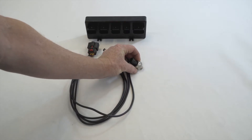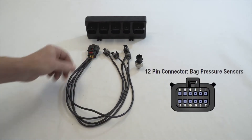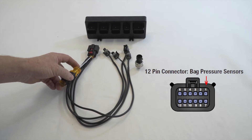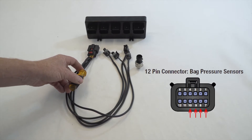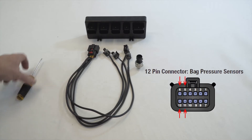The connector is the last one on the end, and it is numbered the same way as the height sensor harness: corner one, front left, is pin number one; number two is front right; number three is left rear; and number four is right rear. The power on the bottom is five volts. It is common, and the four earths on the end are all common as well.